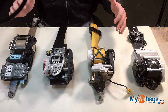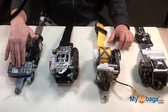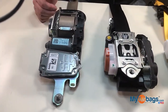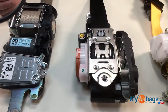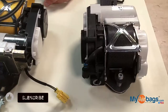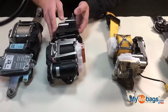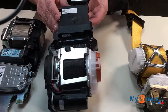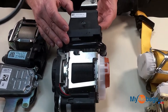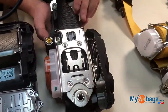These are the latest sophisticated seat belts where you can see they have computers, and some of these are motorized. What that means is they're just getting smarter — more modules, more sensors, more detection. This right here is one from a Mercedes-Benz where you have a computer here, and a lot of times if you swap these out you still have to additionally program these parts.